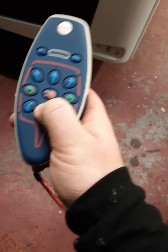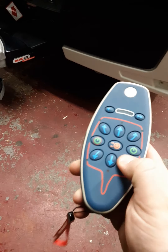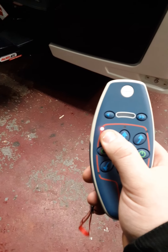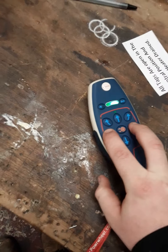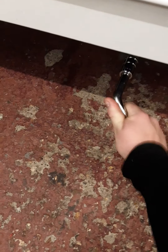Now move on the mover — you can go forward, backwards, front towards me, front away from me, and reverse. Once finished, disengage the wheel. Turn off the handset using the two green buttons again. Lift the handbrake, turn the key anti-clockwise, and then disengage from the wheel. And that is it, thank you.